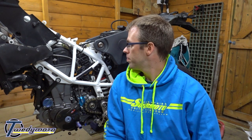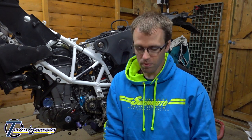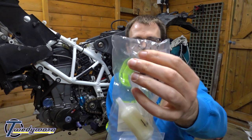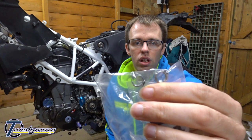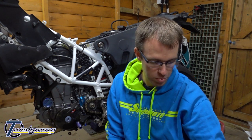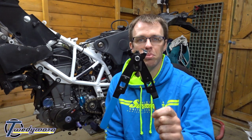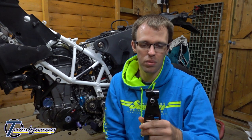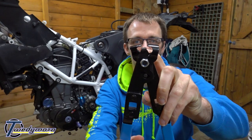To get started it's a good idea to have as little fuel in the bike as possible - not like me leaving it with half a tank. Run your fuel as low as you dare or drain it. I've used an electric siphon pump. If you are fitting one of these again you'll need some of these fancy single-ear clip hose clamps. You might get away with stainless hose clamps, but these are for fuel injection hose pipes as they need a bit of pressure. These fancy pliers squeeze the hose clips together; if you don't have them you might get away with a set of mole grips.